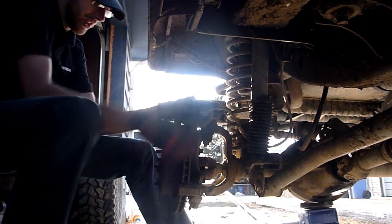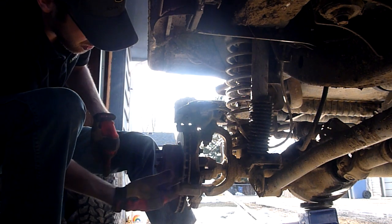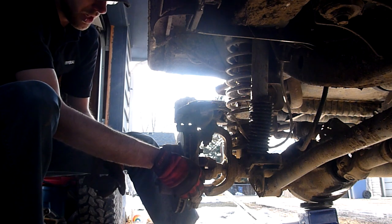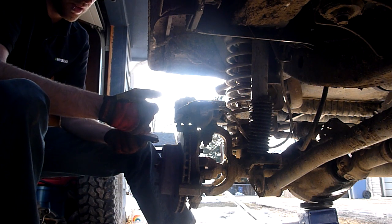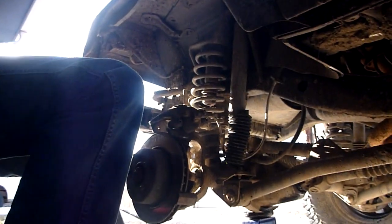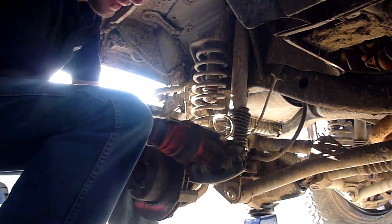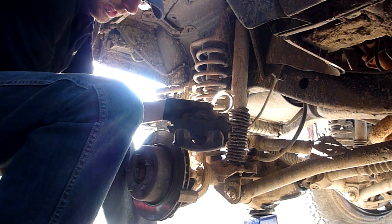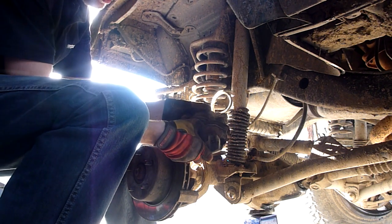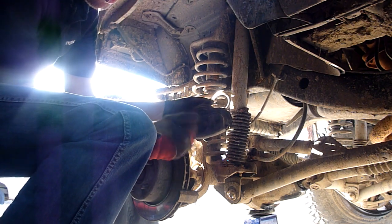That's why I have steel-braided brake lines. Whenever you're installing these pads, this piece right here is going to slide on this metal bar — you can add a tiny bit of grease on the metal bar just to keep it from seizing up. Make sure you don't get any grease or oil on the pad itself or on the rotor. That clip just pops in like that, and this pad just slips in. Make sure those little pins are in the little recess here.